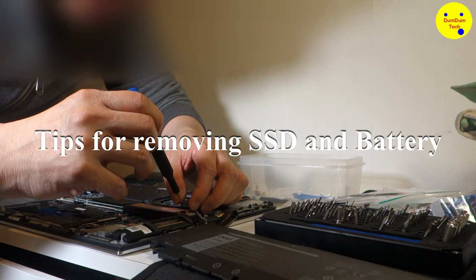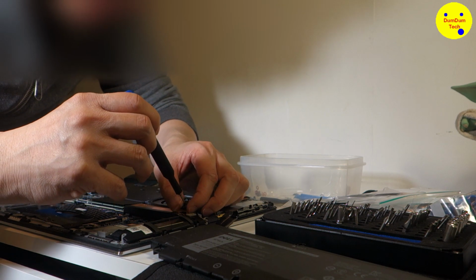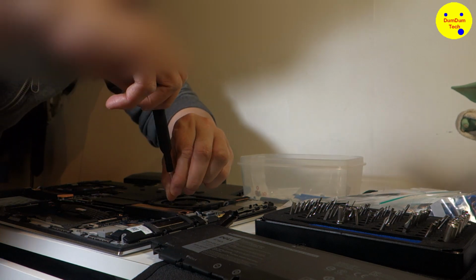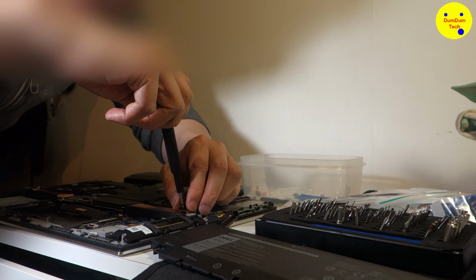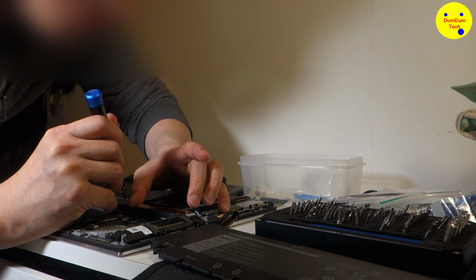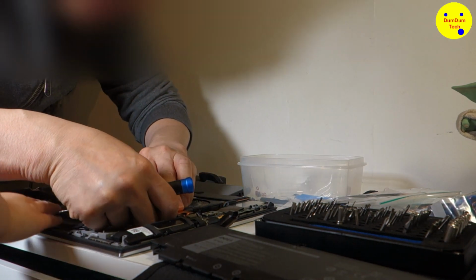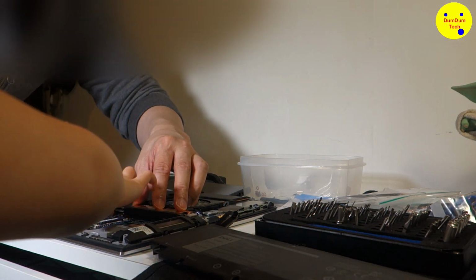So I'm taking out the SSD 2 terabyte drive from the SSD 2 slot in the Dell XPS 9700 and trying to put it into the SSD 1 slot. Right, to get to the SSD 1 slot, you have to undo the battery. Unfortunately, there's several M.2 screws, which are the same size as the SSD mount screws, which is a pain in the neck. I almost got stuck undoing a few because the screws are so fragile.